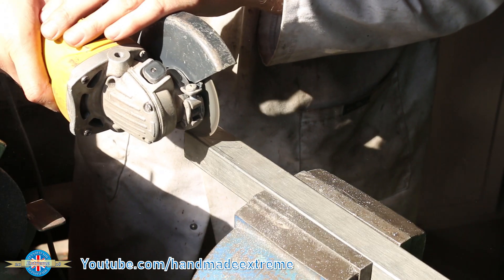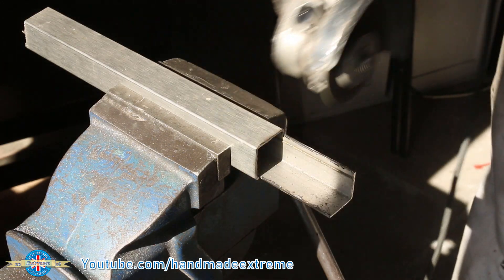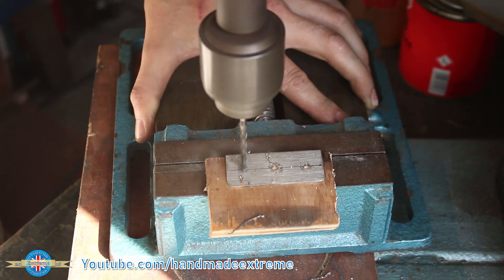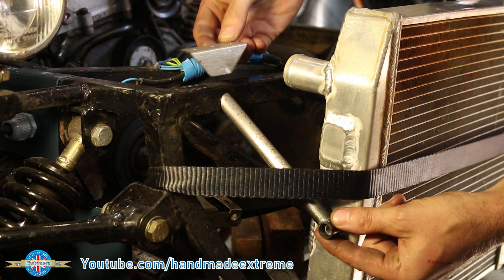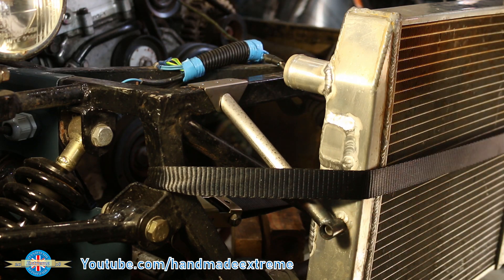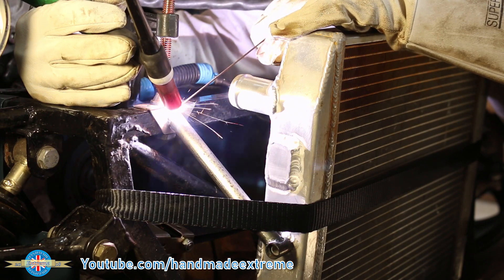On the other side of the radiator I just want a single support bracket and I want it to be removable so that I can get the radiator out again if I ever need to. So I cut down some box section to make a little piece of angle, and this will be the bit that connects to the chassis rail itself. I put some holes in it for some pop rivets — I can just drill them out if I ever need to remove it. So instead of the tube being welded straight to the chassis like on the other side, I'm going to weld it to this plate and then the plate will be riveted to the chassis. I just tacked it together while it's on the car so I know all the bits are in the correct place, then took it over to the bench to weld it up fully. TIG welding at the bench is so much easier than doing it out of position — you can get nice and comfortable.